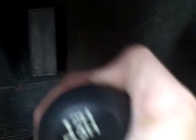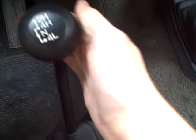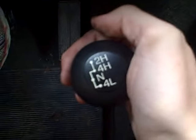So the next selection — while the hubs are locked — you can put it into neutral, which means the truck won't go anywhere. And then you can move it one more into four low. In four low gear, you only really want to take it up to 30 miles an hour max. Four low is when you're rock crawling, in really deep snow, really deep mud — just crawling over stuff. Four low is like a tank setting. So when you're in four low you don't want to be driving fast at all. And also, don't ever put your vehicle — unless it's full-time 4x4 — in 4x4 mode on the pavement, because you'll ruin all the components and it'll make your truck ride really rough and jerk and just go crazy. So don't ever do that.